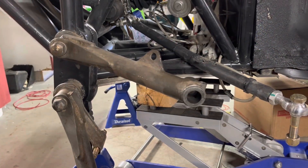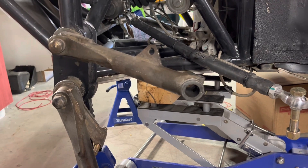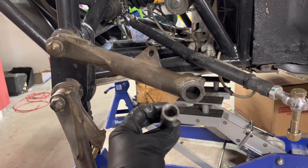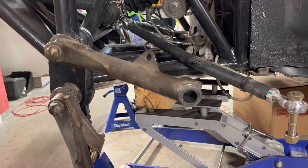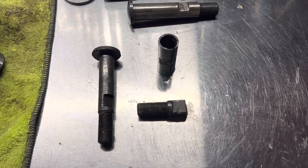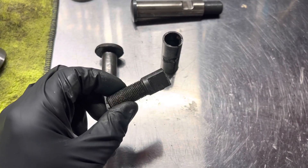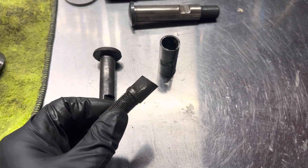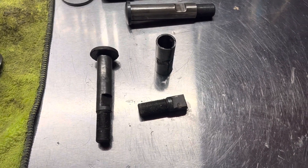The reason I'm making this video is because I had a set of Woods arms that were seven-eighths link pins and I had Tweed spindles which were five-eighths. Rather than upgrading the spindles, we chose to run a bushing inside that reduced it to five-eighths. One day while off-roading I bottomed out the left front suspension and put all of that energy through my link pin — it could have been a little loose, but the smaller diameter of the five-eighths link pin ended up shearing the link pin off just like that.